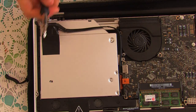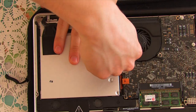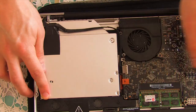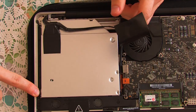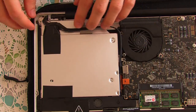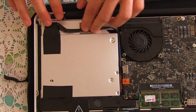Using the same screwdriver you used to open up the back case, install the three screws that supported the SuperDrive down to the main body. I'm returning to the tape again because the position of the screw holes simply do not line up. Carefully align your cables back in place and put any pads back where they were if they've fallen out.